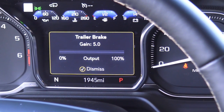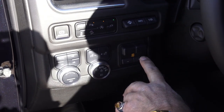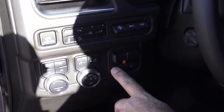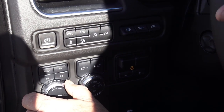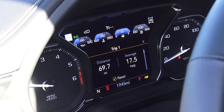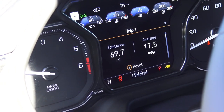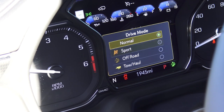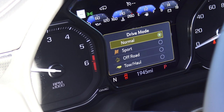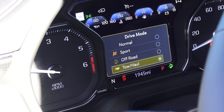Before I take off, I'm going to find the mode. I just raised the gain up to 5; I may go a little higher. Here are your modes — there's normal, sport, off-road, and tow/haul mode. I put it in tow/haul mode using the knob below the four-wheel drive buttons. This thing has a whole list of things for your trailer: status, checklist, trailers, and settings. It detects the trailer — that's on. There are maintenance alerts — you could set a 5,000-mile brake reminder. There's also a theft alert for the trailer.